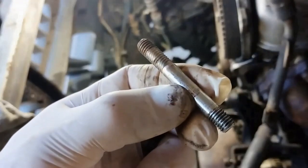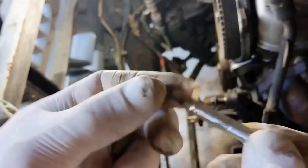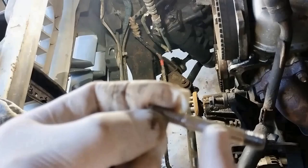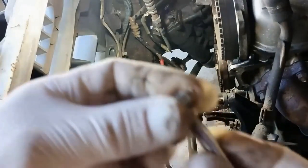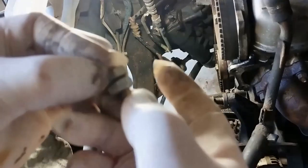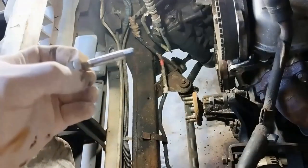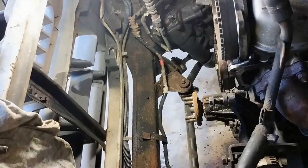What actually happened here was the nut rusted onto the end there and I've got the nut off. I had to put it in a vise very tightly and I did do some damage to this area - it doesn't matter because I filed the burrs away. I've got two nuts to make a lock nut. If I thread that on there and thread that on there and tighten this bottom nut up and tighten them together, I can then turn it in - and apparently this is from the pivot point of the belt tensioner.